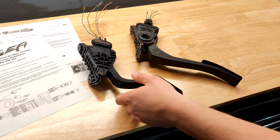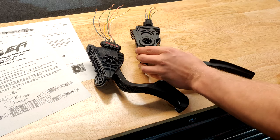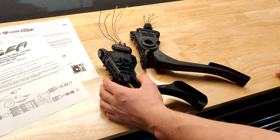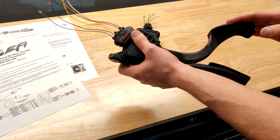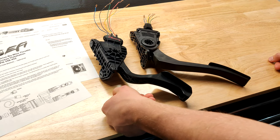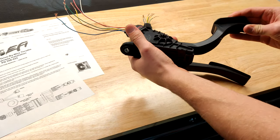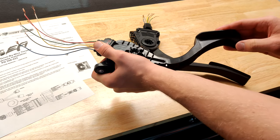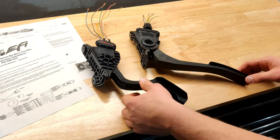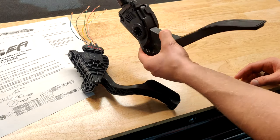These two pedals are both called Hall Effect Sensors — this one from a Toyota Prius, this one from my 2010 Ford Escape. The way they work is you give them a constant five-volt power source, and depending on how far the pedal is pressed, it will output a signal voltage between zero and five volts. When it's not pressed much at all, the voltage will be low, maybe in the one to two-volt range. When fully pressed, the voltage will be higher, around four volts generally. That voltage range does vary somewhat between pedals — you'll see this Prius pedal outputs a different voltage than this Ford Escape pedal.